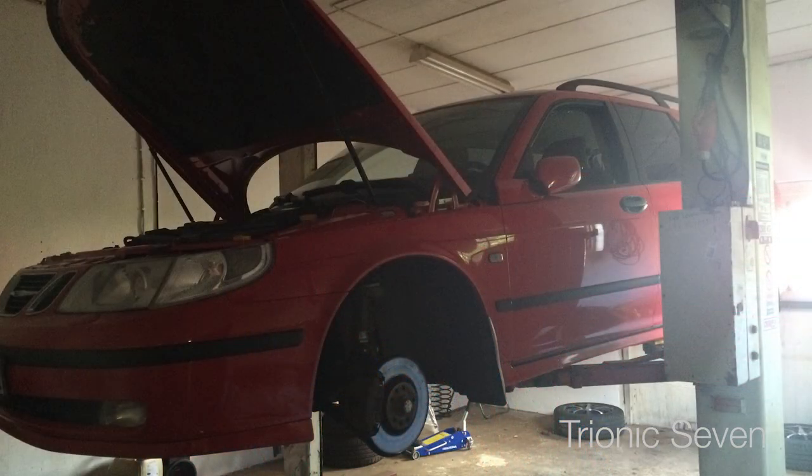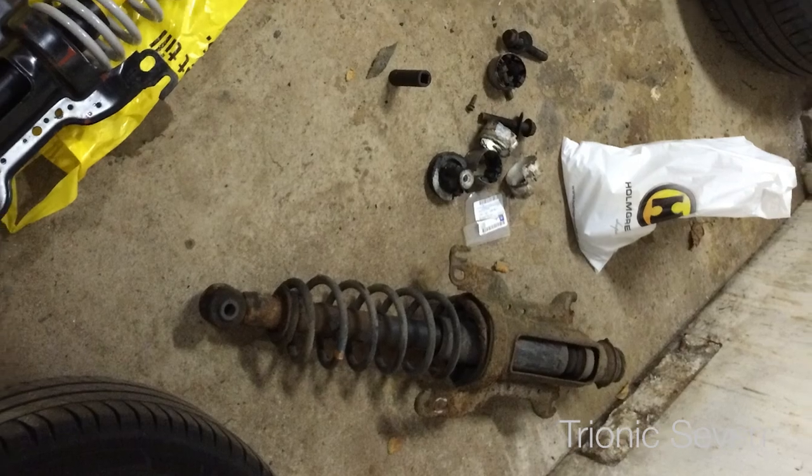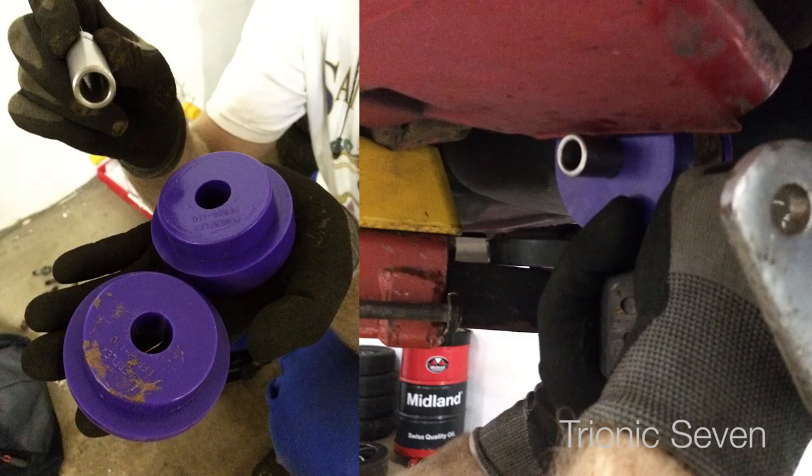Last winter I did my winter project for my Aero, and I didn't have time to make a video unfortunately because I was quite stressed out that weekend. I redid the suspension — I put lowering springs on, which means I lowered the car, I put in new rear shocks from Bilstein, and I also replaced the rear bushings in the suspension. So that meant the suspension became much better, it didn't sag in the rear end, and I was able to turn and steer much quicker than I used to. It completely redid the feeling of my Red Aero.